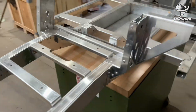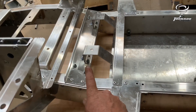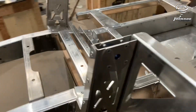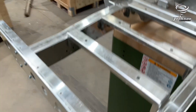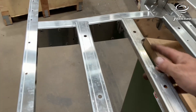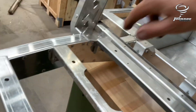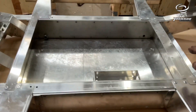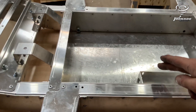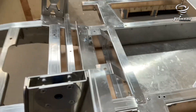I bolt on the rear folding top brackets as you can see there. Underneath you can just see them. The reason these cross members are different — for the floor or the seat support — that one's plain, that one's got the cutout for where the four-link comes up, and this one here has cutouts where it slides down. That's why they're all different even though they look similar. When building the chassis I put this cross member in, then that cross member, then the floor section, then work forward or backwards one part at a time until you get all the way to the back or front.